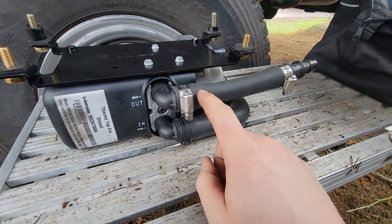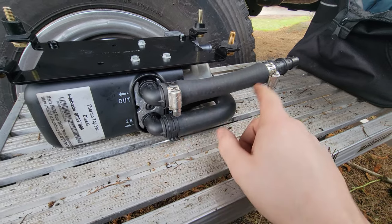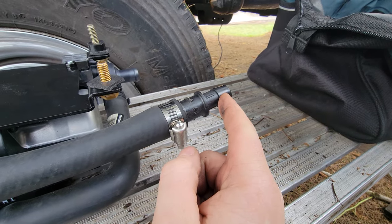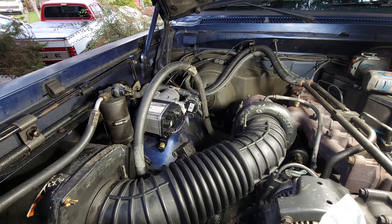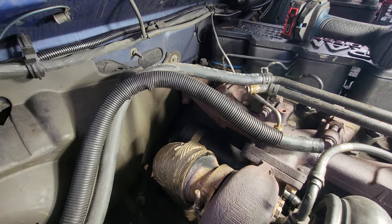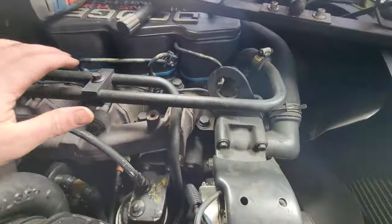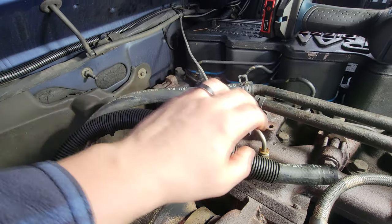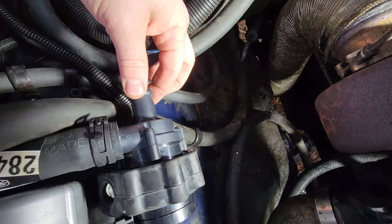Before installing it on the inner fender, I ran some three-quarter-inch inside-diameter hose because I won't be able to access it from this side once it's installed, along with two stainless hose clamps. The kit comes with adapters to go from three-quarter-inch inside diameter down to five-eighths inside diameter. Before making the connections to the Webasto with the heater lines, I back-flushed the heater core a couple times to make sure it was cleaned out. The feed line is on one side and the return line on the other — I flushed each direction a couple times, then I'll put the feed line back and cut a spot to connect it to the coolant pump.